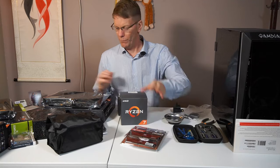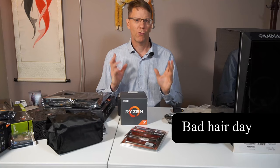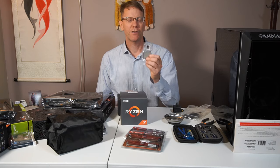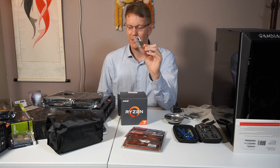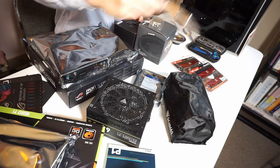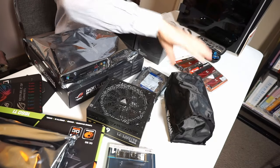So let's get started. We're going to open up our motherboard, put our memory and CPU on, then put it in the case and add everything else. We have 32 gigabytes of memory because you use a lot of memory when editing 4K video. We have a Ryzen 7, which is 8 core, 16 threads. My previous Intel i7 had 4 cores and 8 threads and I would max it out at 100%, so I definitely needed more. We have an M.2 SATA, which is the fastest memory you can get. We have a 4 terabyte hard drive to save all our data, and also a NAS - a network attached storage - where we move things after a while.